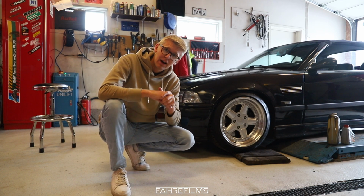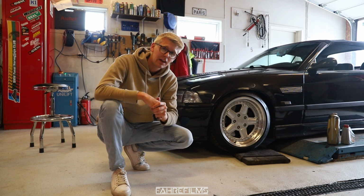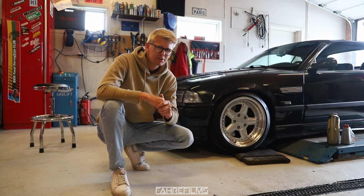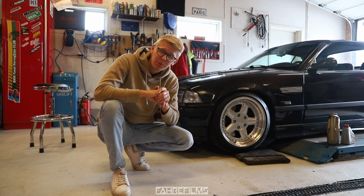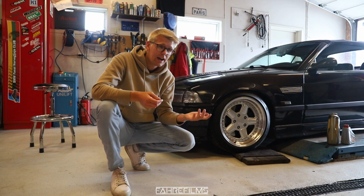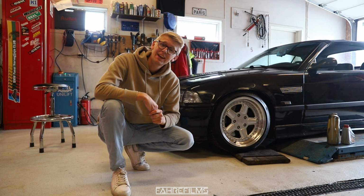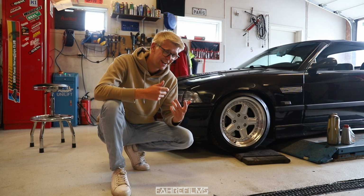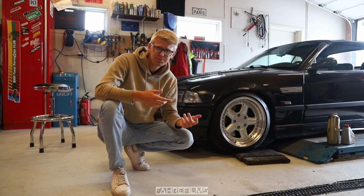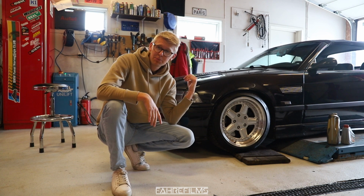And actually, a thing that I have not talked too much about in my videos is that my power steering has been quite bad. It has been very hard at low RPMs, and that has been quite annoying. Yesterday when we removed the power steering because of clearance issues, I asked the guy that I'm here with, do you have a power steering pump left over? And he actually did. He has a lot of parts, so he had an M50 power steering pump, but those are the same as the S50. So we have now swapped in a used power steering pump that works great.